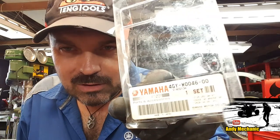Plus, we found that the sliders were dry. We cleaned those up and put some copper paste on so that the caliper moves freely and the pads can come away from the brake disc whenever the brakes are taken off - normally when you take your foot off the brake pedal. As regards what we used - obviously the parts, and there's the part number. Good old Yamaha stuff. We used some copper paste and some emery cloth and a few spanners.